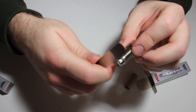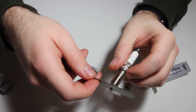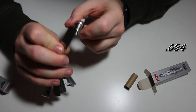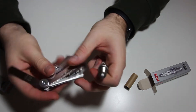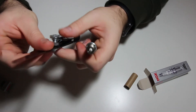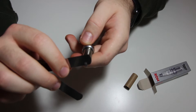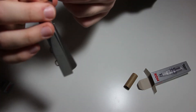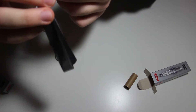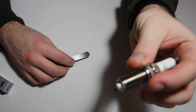What will happen is you'll be able to slide it in, barely, but there will be a slight resistance when you try to slide it in between. The 0.024 will not fit in between, but the 0.022 will fit in and you'll feel a little bit of resistance trying to pull it through, but it will fit. This spark plug has been gapped to a 0.022 gap.